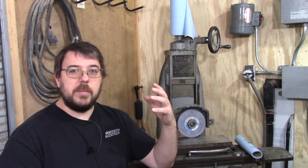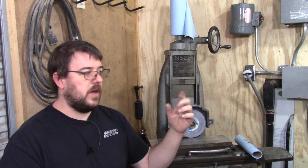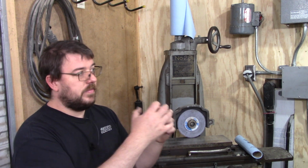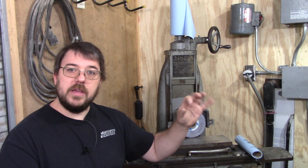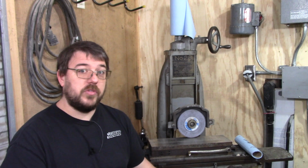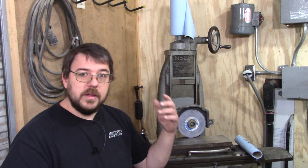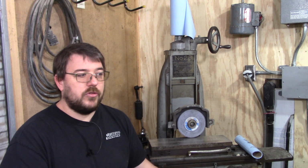That'll reduce the amount of friction that we see in the motor. Hopefully that'll reduce the amount of lash adjuster collapse that we see in the motor. And actually, that's another thing too, right? We'll be able to see just how much the lash adjuster is collapsing using this. So hopefully we won't see any of that, but maybe we will. And certainly, if we see too much lash adjuster collapsing, then the answer becomes easy, right?